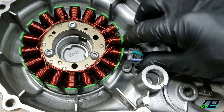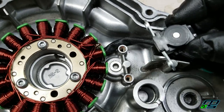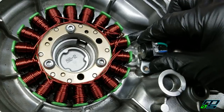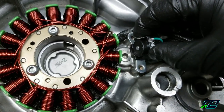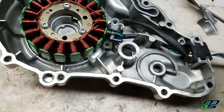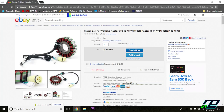I got the grommet in, but now this crankshaft position sensor doesn't fit. It has these little shelves on the bottom so you can't adjust it — it has to fit in there just right. You can see it'll fit in one side but not the other. It's too damn wide. I do not recommend buying this, even if it works.